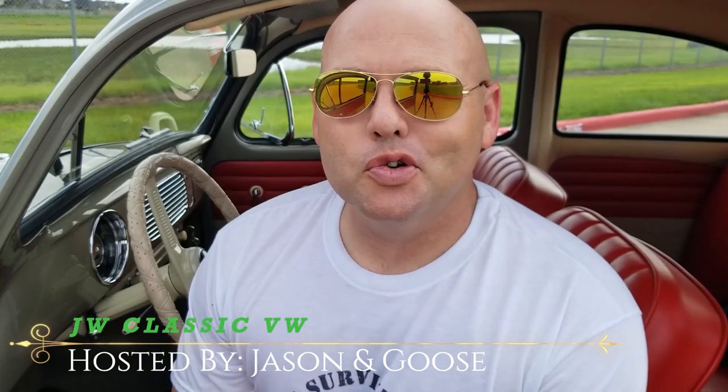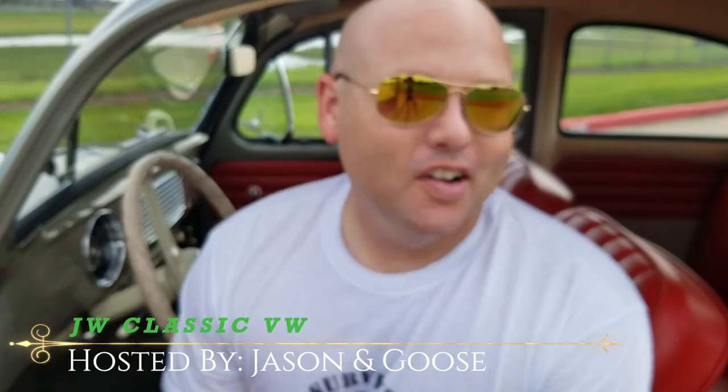This is Jason with JWClassicVW, and today I'm doing the episode from my kid's school in the parking lot. I thought I would change the scenery up a little bit so that you guys could be in a little outside environment instead of inside the garage. Yesterday I was driving around and I retarded the timing to 28 degrees at 3000 and she was running super hot. I'm going to go ahead and check that timing with you guys so you can see what I'm doing when I'm checking that timing.